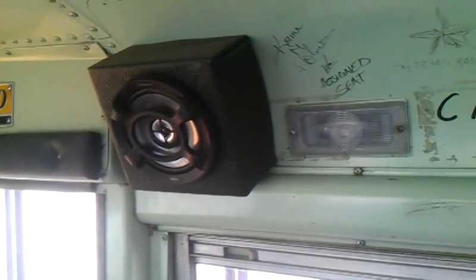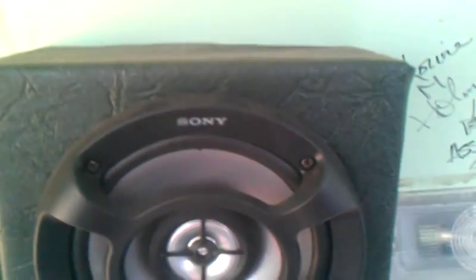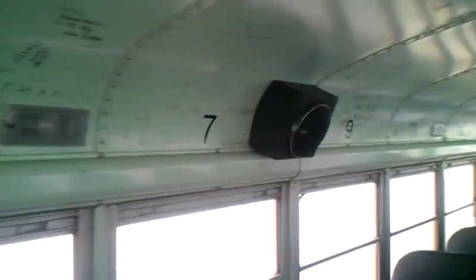You don't have to worry about disposing of the old one. So I was able to go through and find some seats that had been recovered, and take the bad covers out from underneath - and that's what we used for the speaker box covers, because it doesn't matter if they're ripped already, they're going to get cut up. We just covered the whole speaker box - it's obviously empty on the back side, basically front, sides, top, and bottom. Then we drilled a hole in the top of this panel underneath the speaker boxes, ran the wiring up from behind, ran it into the speakers, and mounted the speakers into the box. We used a couple of angle brackets inside the speaker box to mount the box to the bus body, and then some sheet metal screws.